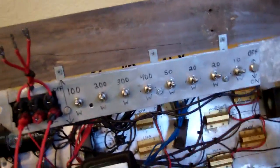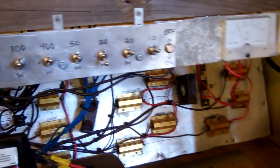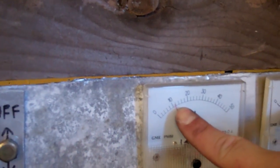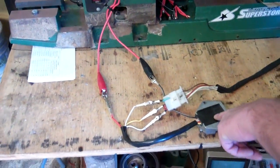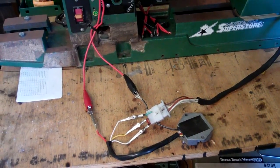So just to test that everything else is working correctly, we'll swap on a couple of loads — about 220 watts. You see our voltage drop now to about 9 volts, and we're drawing about 11 amps of current. So everything works fine on the rectifier side. The stator is producing current, the rectifier is working just fine converting it to DC current, but the regulation system is not working at all.